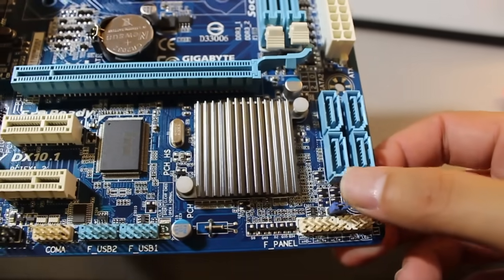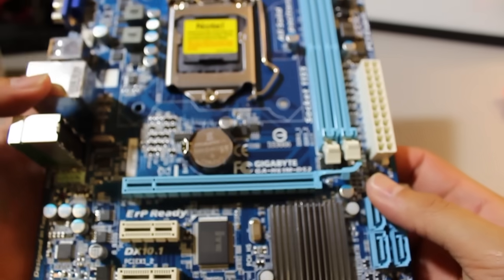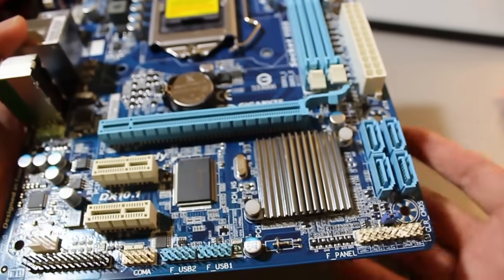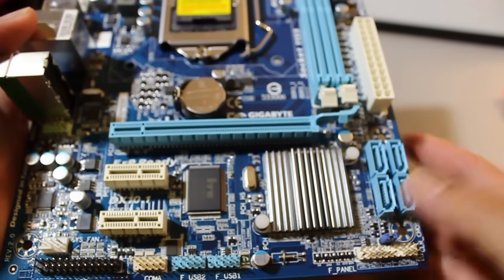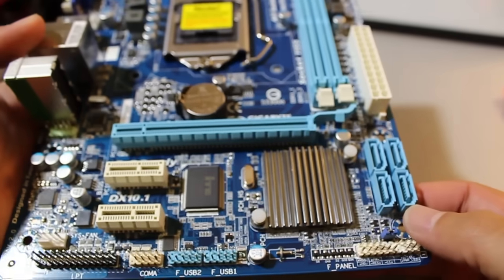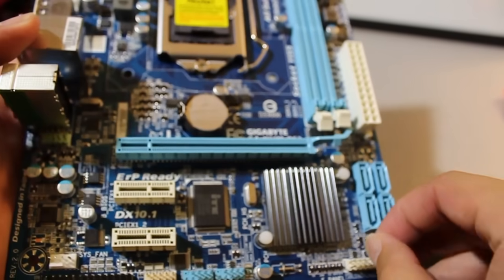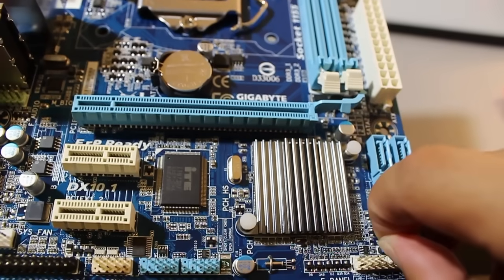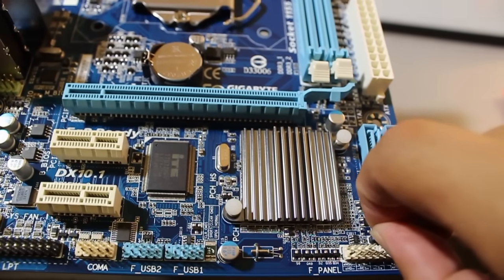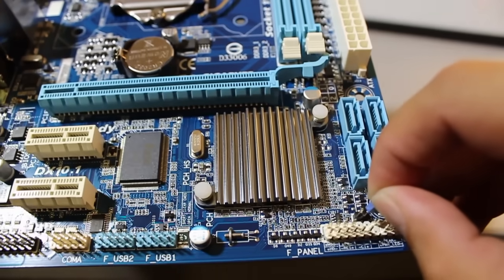The system has to be plugged in and you have to actually hit the power button and turn it on. Most motherboards I've come across — when you do so, nothing happens. I don't know why that is, but basically nothing will happen. Some motherboards, however, will actually turn on but nothing will display on the screen. Either way, both of those times, most likely you were successful. If it does nothing, you're most likely successful. If it does turn on but nothing shows up on the screen, again, you were most likely successful. It's kind of a crapshoot — there's no way of telling positively.